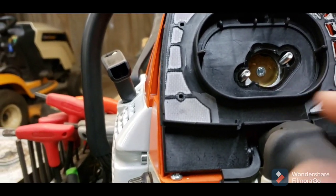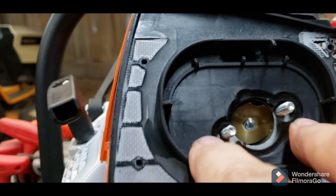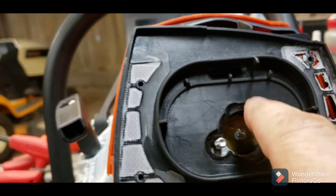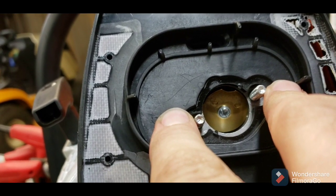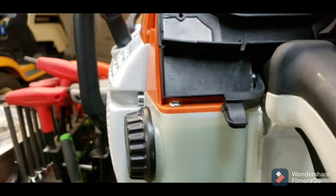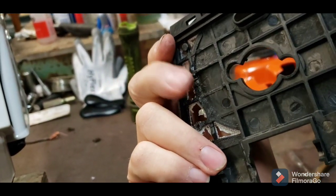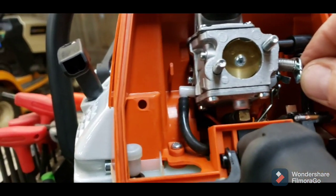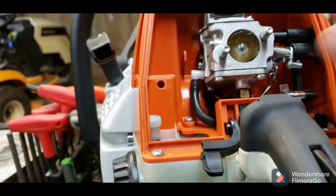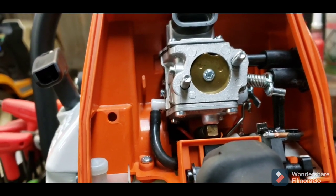You get this in place — you see the choke is still closed. But when you pull that down, see how that choke starts to open? Let's push that choke all the way closed. See how that opens the choke up with this all the way tight? It's actually the back of this panel right here, where my finger's moving, hitting this arm — this choke arm — and it's actually pushing that choke open a little bit. And that makes it really tough to start.